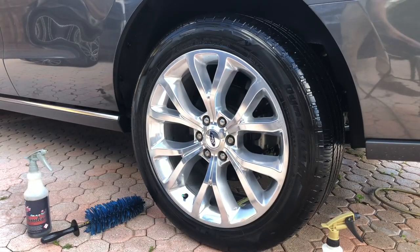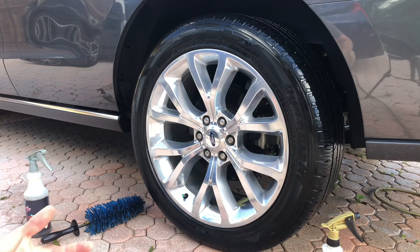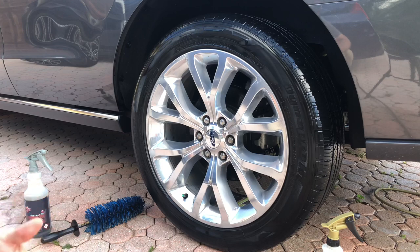So that's a good thing. Overall, if you find yourself going over to O'Reilly's, pick up a gallon of this stuff — they'll have to order it for you. In all honesty, you know me, I love Chocolate Thunder. I find this product is like Chocolate Thunder just amplified by a level. So if Chocolate Thunder is like an 8 on the aggressive scale, I think Rage is probably a 9 on the aggressive scale. The way I predominantly use it is diluted 1 to 1, spray it, rinse off with a pressure washer, and move on. But I knew I was going to need agitation, so I went with the 4 to 1 dilution ratio for the contact wash.